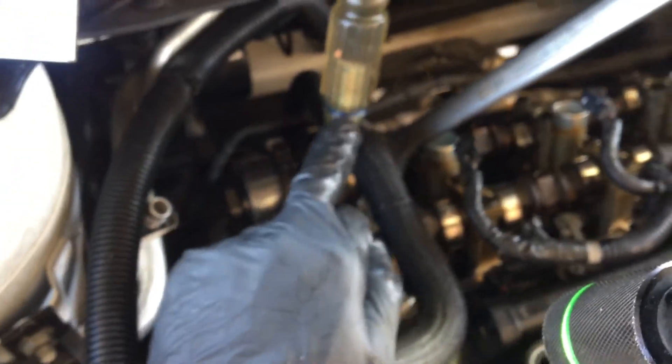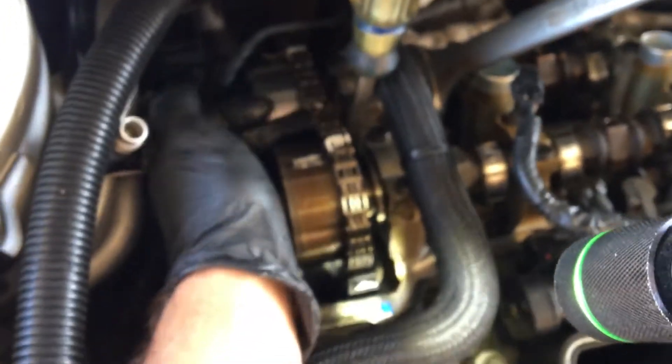Like that, I was able to lock that guide back in the loose position. Prior to that, I actually took the bolt out first, then quickly took off the old cam phaser while the chain was loose, bolted the new one on, and finished tightening up the bolt so it doesn't pop out. I'll show you that I've successfully changed out that cam phaser without any special tools at all.